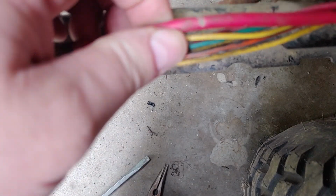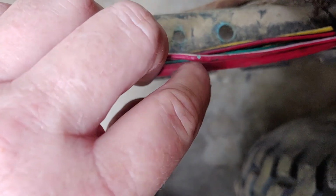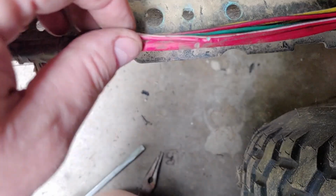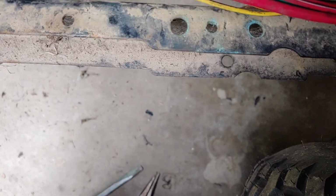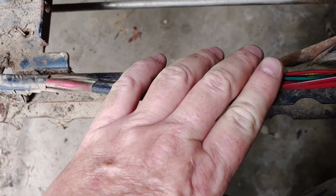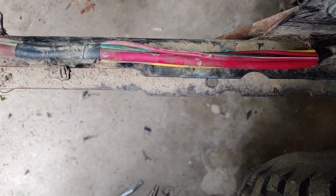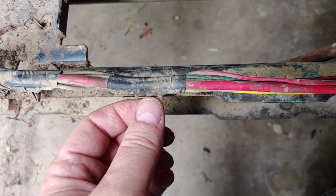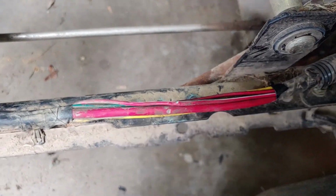You know, there's a lot of pixies in this wire. Anyway, we'll put a little protection here and pull out this section of wire until I get back to good copper and splice in a nice splice, and have a good look at how much space is in the fender. Probably none. If there's any extra wiggle room, we'll try to put some wire loom around it, something extra to buffer it. Because this was right where one of these wire anchors was, so it could have been just vibration, but I don't know. But it does look like we found it though.